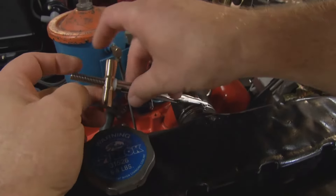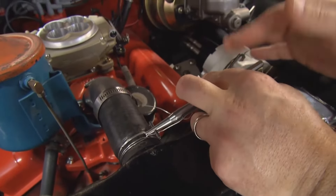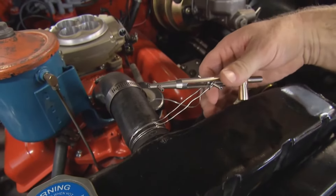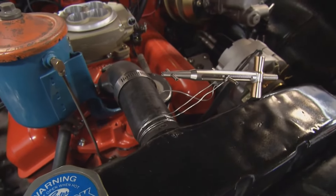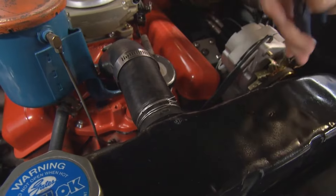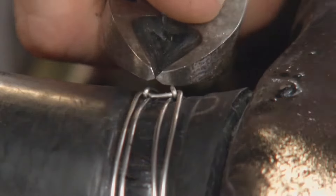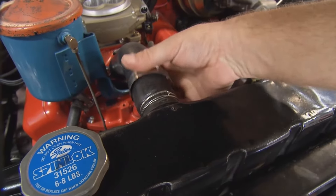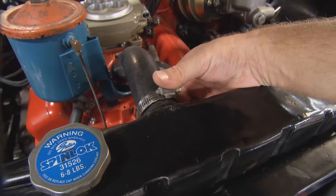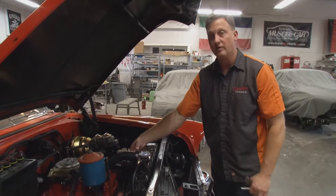So we're tight. We're going to go ahead and flip that tool all the way over itself. Back that nut off — the tool pops away. At this point you're going to take a pair of cutters. About a quarter of an inch is all you need. Once you press those down, that is your brand new, ten times stronger hose clamp — better than those classic clamps. If you do want the classic look, you can take that hose clamp and just slide it over top, so you have the new style clamp that works a lot better with still that classic look that belongs with this car.